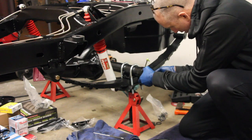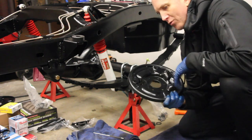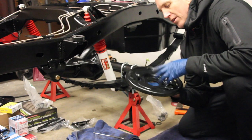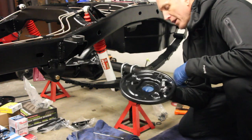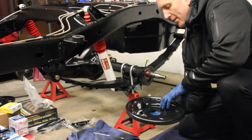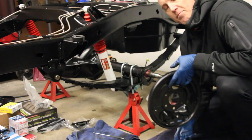Putting on the shims, then taking the backer plate — these backer plates, nobody makes them anymore. So if yours is rotted out, you're just going to have to find somebody that has a set. They also come in two different sizes depending on the rear brake size of your CJ: 10-inch rear brakes and 11-inch rear brakes. These are the 10-inch rear brake backer plates and they're stamped as to which side they go on. This one is stamped 3-2-4-3-2-4-L, designated as the left side; the other would be the passenger right side. These are apparently all made by Bendix.